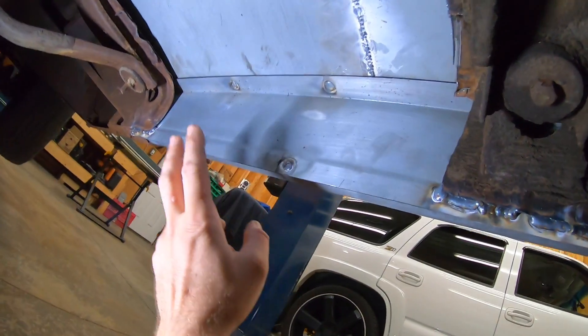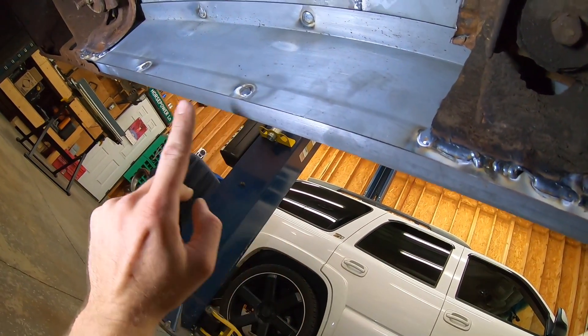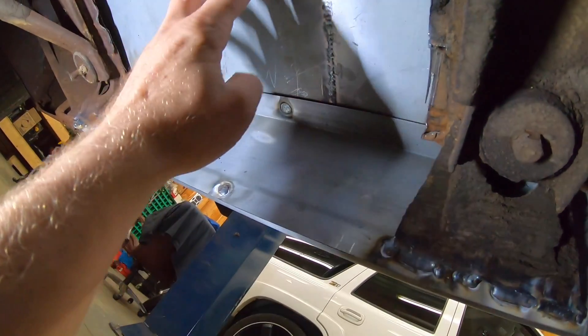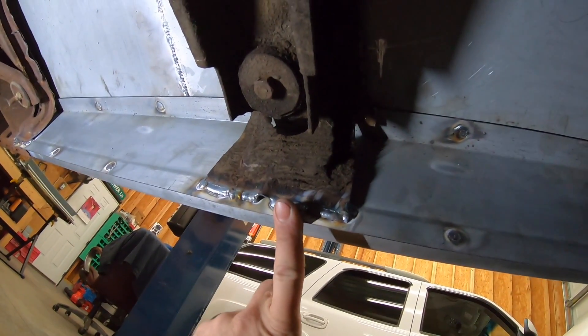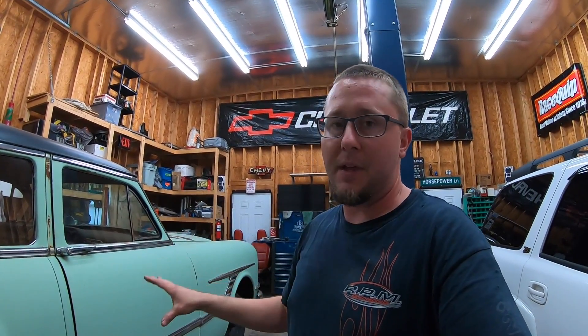Moving back up under the car, you can see that this turned out what I would call nice. I didn't want to weld this seam the whole way down - I wanted to keep it factory, and in the factory they spot weld all this stuff together. The floorboard is welded solid to this piece, and these two pieces are welded together, welded to the frame mounts. I stood on the floor yesterday and it's solid. Unfortunately this is the kind of stuff you run into when you're restoring an old car, and they don't make parts for this specific car. They make Packard floor pans and rockers for different models or trim levels, but nothing exactly for this.